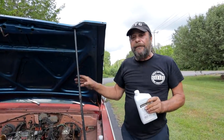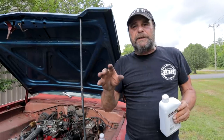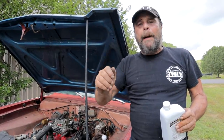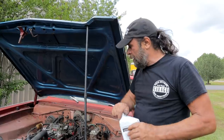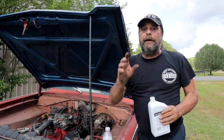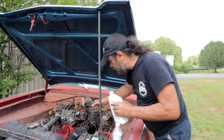Many times a customer would bring a car to you, the mechanic, and it would backfire rhythmically up through the carburetor. Every time you give it gas, it would go pop, pop, pop, pop, pop. It was a stuck intake valve, and that was that varnish. It was very, very common. So you're doing this to either repair that type of damage or as a preventative measure.